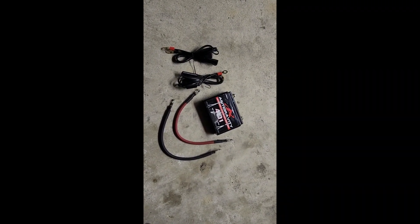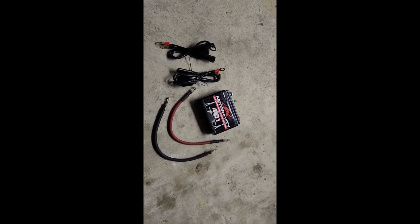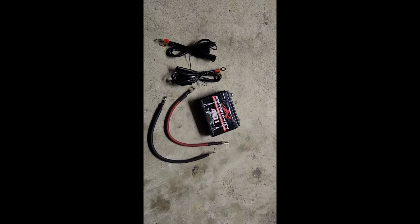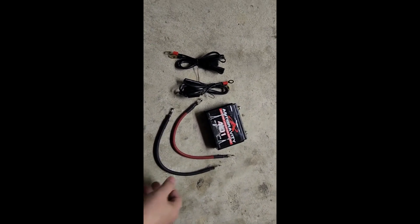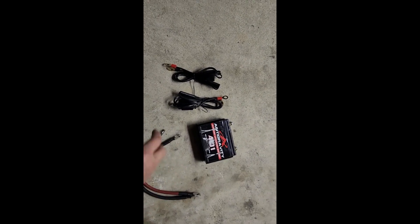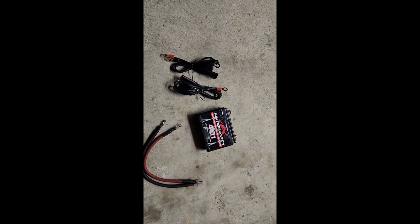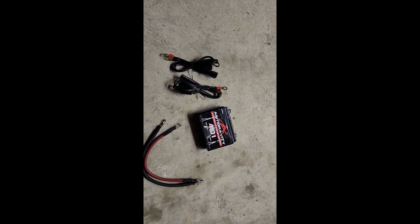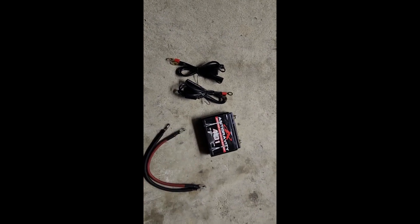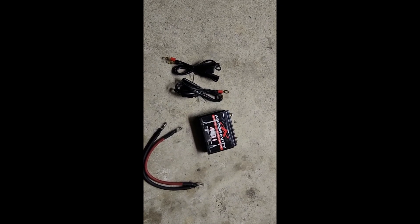I have a four-cell Anti-Gravity 401 lightweight lithium battery. You really only need one eight-gauge cable and then two little remote charging cables, which make things very handy. The reason for that is that the four-cell battery will have to be charged manually — it will not be charged by the charging system on the bike.